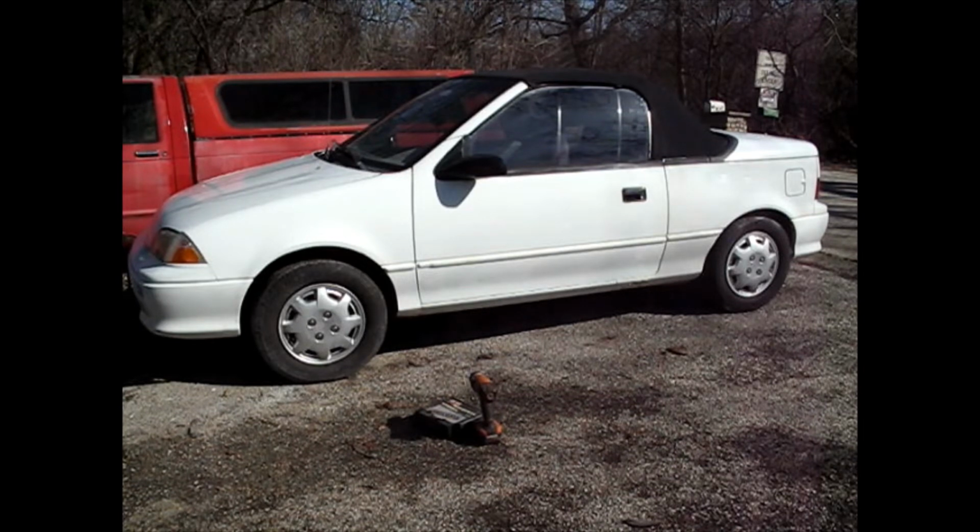It's a little bit of a low pedal and a little bit difficult to press, almost like one of the circuits isn't working or leaking, but upon inspection I find that the brake fluid reservoir seems to be still full. So I'm just going to pull each wheel off and look at what's going on. Maybe just the adjusters are stuck in the back or something. I'll pull them off one by one and see what condition everything's in.